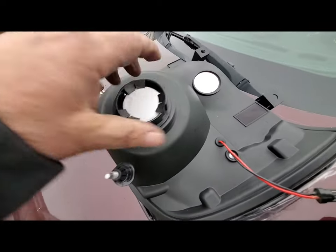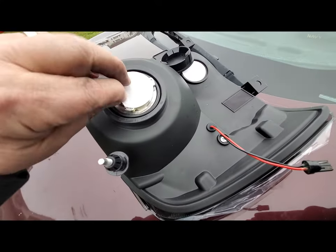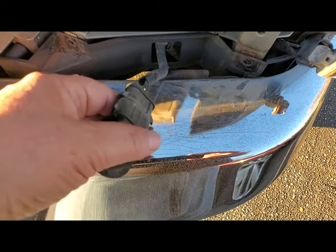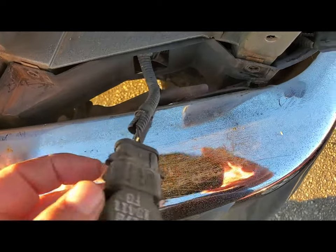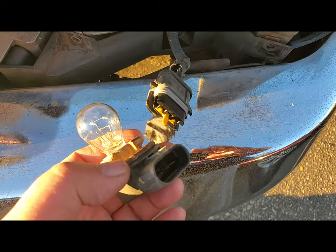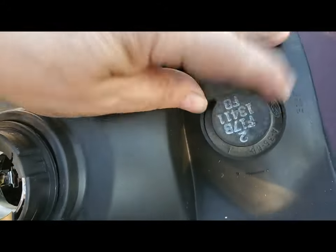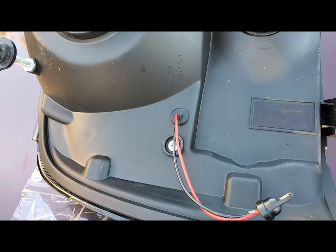For your new light, go ahead and take this portion off if it's this particular brand. You'll need to pull the stickers off and set them aside, and make sure you remove all the residue. After you get the headlight assembly out, remove the light bulbs — this one just pulls out. These normally have a tab on each side; lift them up and pull. Then install the bulb in your new light system: these have one large tab and two smaller tabs — locate the large tab in your new assembly, stick it in, and turn it clockwise.